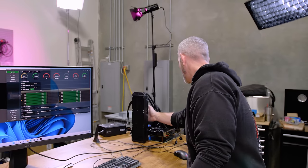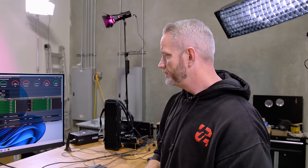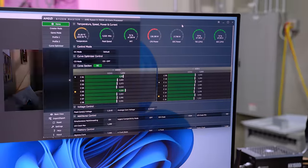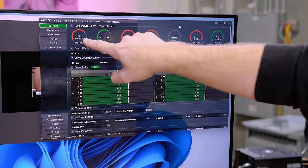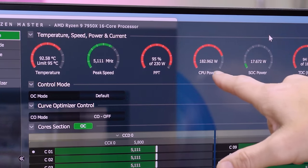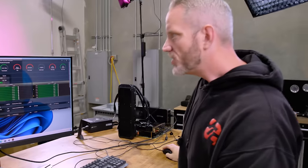I am re-running some baseline testing right now because it is significantly cooler in this room than the last time we did this video. Temperatures finally started to come down in SoCal, so I need new baselines. Interestingly, one CCX only goes to 5.02 GHz and the other goes to 5.12 GHz. At 5.2 all-core, we're hitting 92C and pulling 230 watts total, with CPU power at 190 watts - that's one of the reasons it's so hot.